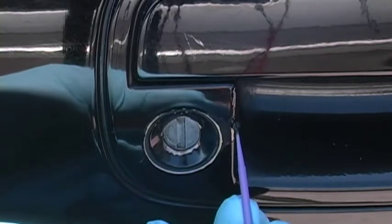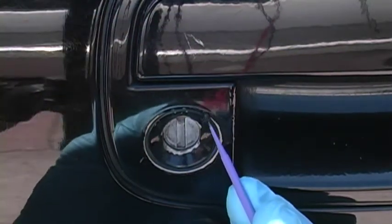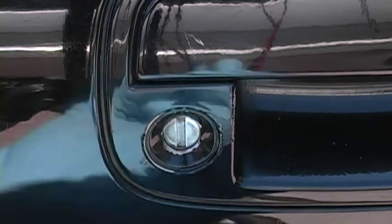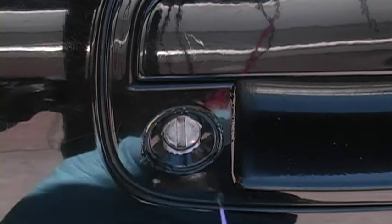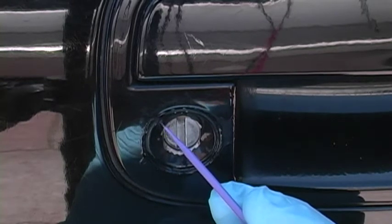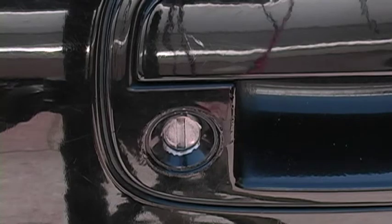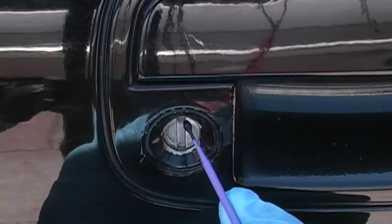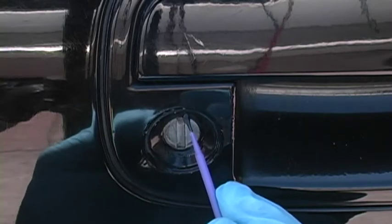Now we're going to do these chips around the key lock area — same thing. I'm just lightly dabbing to lay a precision amount of paint on there. You can almost see in the cup how little paint is actually in there. The reason you want to use so little is it skins over and dries pretty quickly, about 10 or 15 minutes, so you want to pull your paint from this cup and not directly from your touch-up paint bottle. The brush head holds about enough paint to go maybe an inch, so I think I got around that keyhole in two applications. These precision touch-up paint brushes will make your work look professional every time — they're very easy to use.